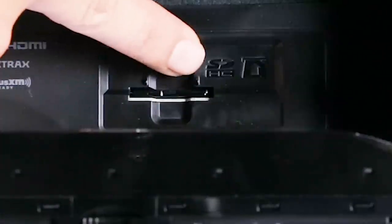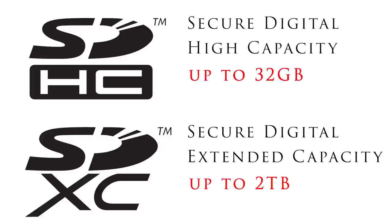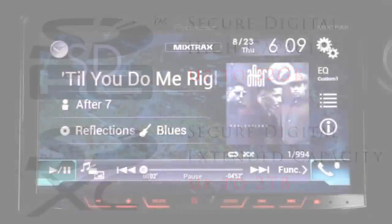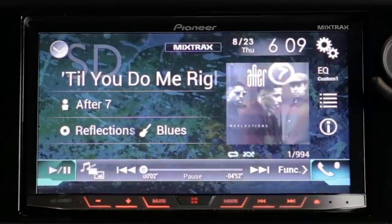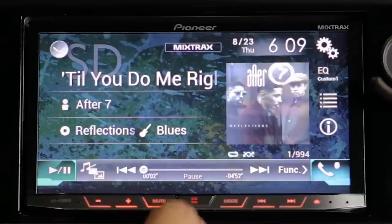The SD card slot is behind the screen and it says SDHC — high capacity SD cards up to 32 gigabytes. You and I both know SD cards come in much higher capacities now, so you'll probably want an SDXC, which are extended capacity cards up to two terabytes. Even though the manual and the unit say SDHC, it does play those extended capacity cards — I have one that plays just fine. That's another reason to always keep the firmware updated.